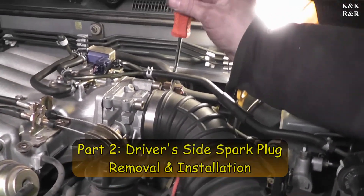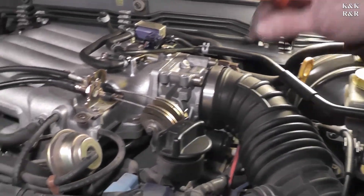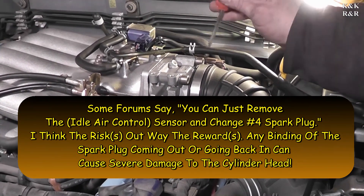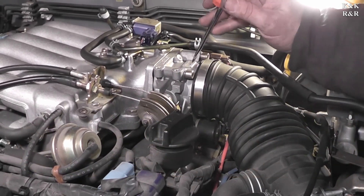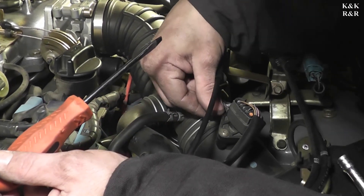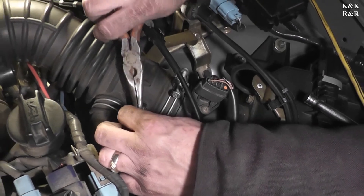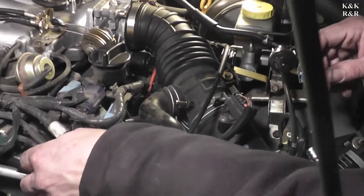I'm going to start this side off by disassembling the air duct so it gives us some room to work in. We've got to definitely unhook that throttle body — those boots are sealed pretty good and I don't want to separate the boot. This is like a five, seven minute job. I'll just take the air tube out in general, leaving the mass airflow sensor intact. Just push these off to the side, leave them hooked up so you can break that connection free right here.